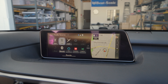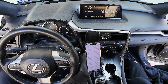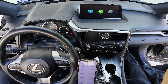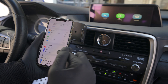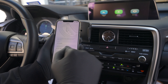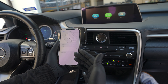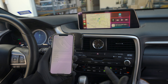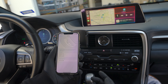Once your phone is connected to the car, make sure you have selected the Bluetooth audio source. Press and hold the map button — this switches the screen over to the three-icon screen showing Android Auto, Apple CarPlay, and settings. This means nothing is connected yet. Go to your phone settings, General, CarPlay, and you will find the NV17W with a numbers and letters combination. Select it and pair. Remember: every time you deal with a wireless connection, only use Settings > General > CarPlay. Never connect from the Bluetooth menu or the Wi-Fi menu, because it will try to connect with a different function and interrupt the wireless CarPlay connection.